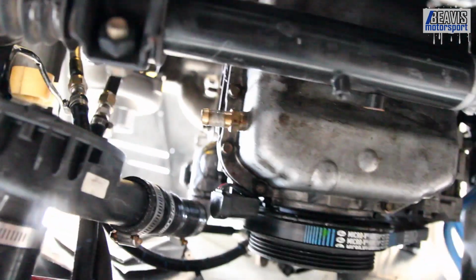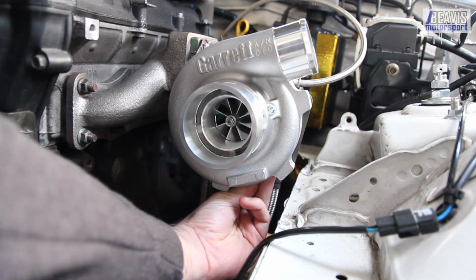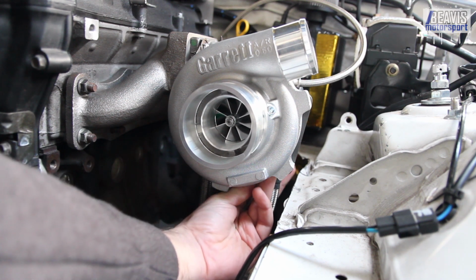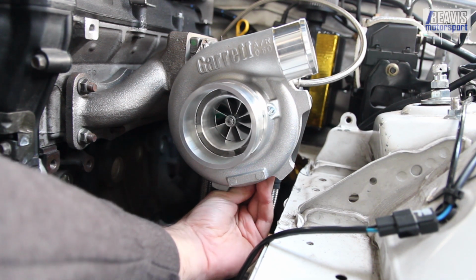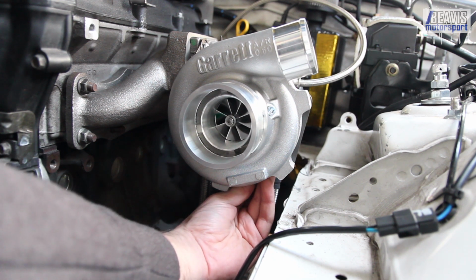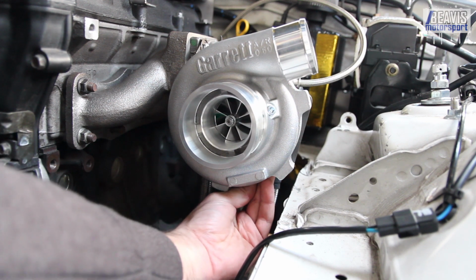And so I've got a fitting to go into the turbo, and we need to run some hose down to the barb. Time to do that. Now, of course, I went and made this difficult for myself by installing the 2 bolts that hold the drain flange in place already in the turbo. So now I need to try and get them out and install that fitting.